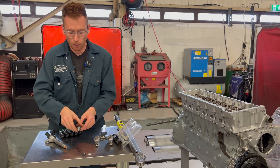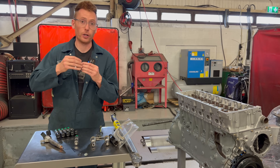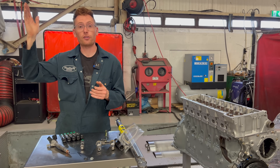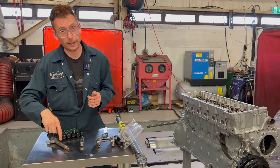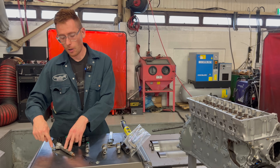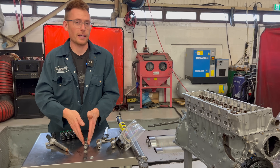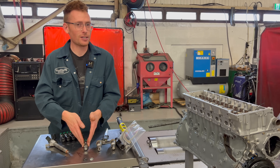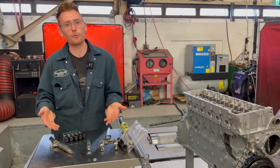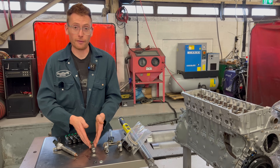Let's talk about injection pressures. As I've mentioned, 150 bar is the opening pressure we set the injector to — that isn't the dynamic pressure. Once it's pushed open at 150 bar, the pressure as the plunger pushes up in the pump continues to increase until it closes again, and can reach very very high levels. The common rail injectors on a 613, for example, run 1250 bar at the rail. But we can't directly compare them — we don't know the dynamic injection pressure of this one. I'd estimate it's probably over 500 bar, though I'm not 100% sure. One day with measuring equipment I'll give you an accurate answer.